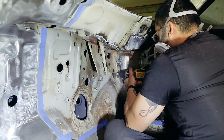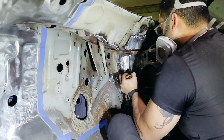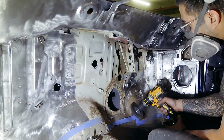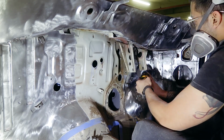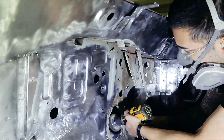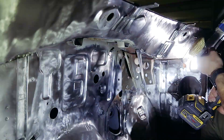wire. I've definitely improved since then and now use a very appropriate 0.6mm gas setup. I've also got a new machine recently that allows me to adjust the voltage and feed speeds independently, which is ultra helpful, and you'll definitely be seeing that in action in future videos.